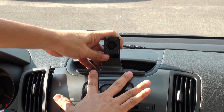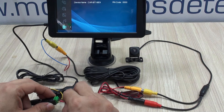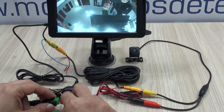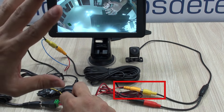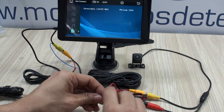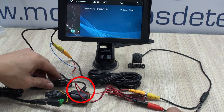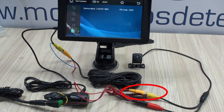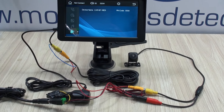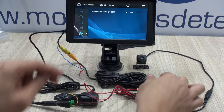Before taking it to your car, it was a peace of mind for me at least, making the reverse camera work right here. We connected the cigarette lighter adapter to our 12V source, and here the AV input adapter that will receive both video and the reverse signal from the reverse light. So when backing up and activating the reverse light, that same voltage will be connected to the video cable and the positive cable for the camera. The negative to the negative of the light bulb. In cars, this is a no-brainer thanks to the color coding — black to black, red to the voltage. It usually takes a couple seconds to activate the screen and show you the video for backing up.